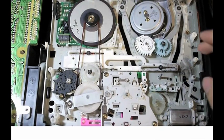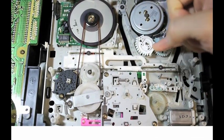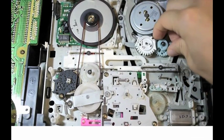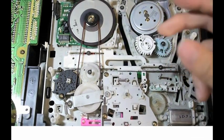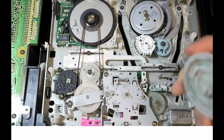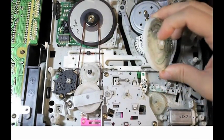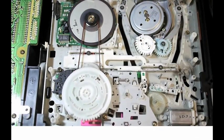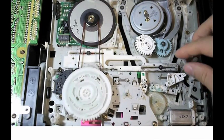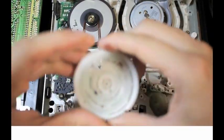To properly place the gears in the tape loading mechanism, after you replace these small gears, you want to make sure the teeth are aligned so that they can retract both tape loading arms together. Then you have this main cam — this thing here — which drives different parts, such as this arm and this gear which matches to the teeth here. You want to have them aligned with all the parts. For example, this one should be here.